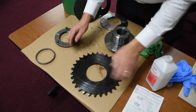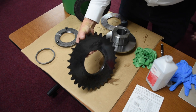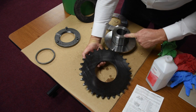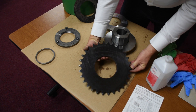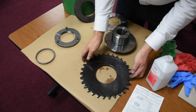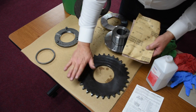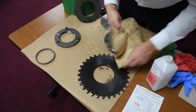While these are drying, I just want to point out some things with this sprocket. This sprocket is matched to the torque limiter, and you can see there are machining marks in that. The surface should be a 65RA or up to a 32RA. The surface has to have machining marks on it in order for this to grip the friction plate. If it's a mirror finish, it's too smooth — then we can rough it up with 100 grit sandpaper, rough up the surface, and you're all set.